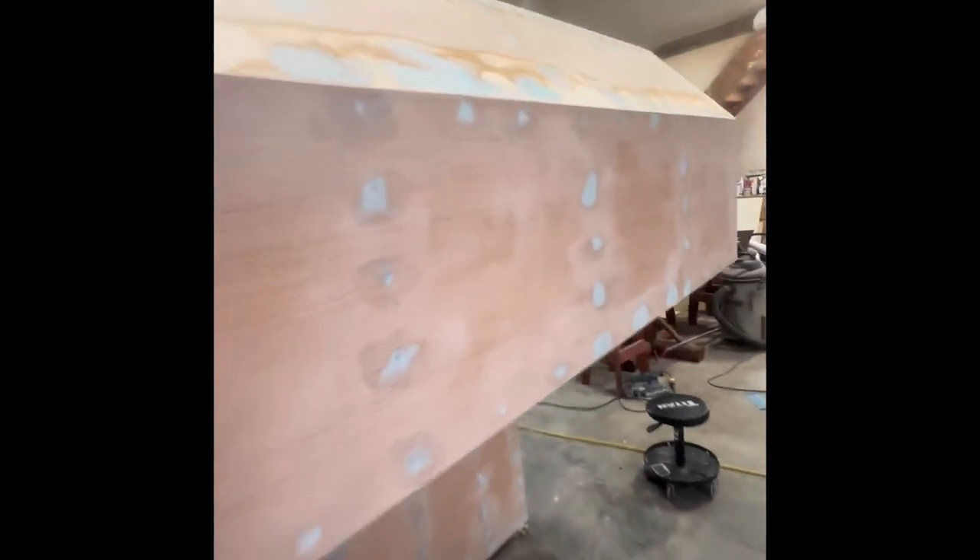My plan is to do the roof and keep it in a little bit on the edges. When I do the sides, front and back, I'll roll those over so the overlap is on the roof, and hopefully I can make the outsides nice, smooth, and flat. I filled all the screw holes with Bondo, got everything rounded and sanded nice and flat. That was the plywood joint there. The exterior is all just three-sixteenths plywood over wood framing inside.